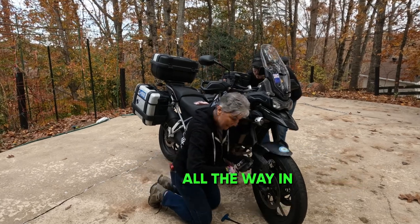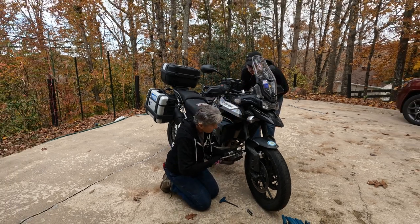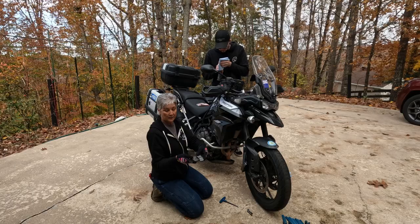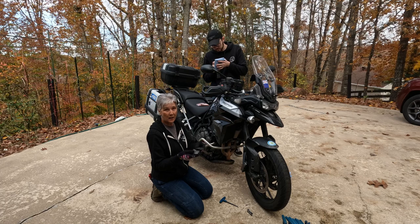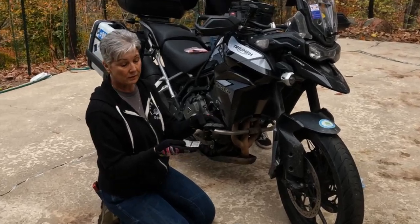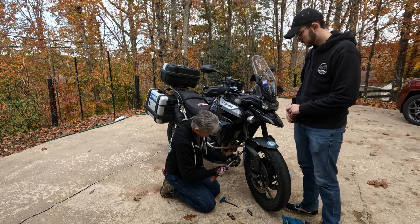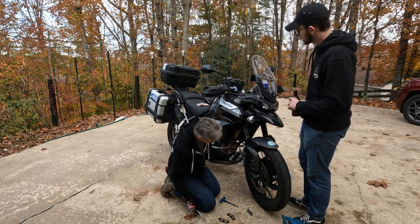You want the pistons all the way in because if they're not all the way in, then the calipers with the new brake pad aren't going to fit — you're not going to be able to put the calipers back on the rotor. There won't be enough room. As you can see, these brake pads are pretty worn down. This was really close to totally scoring my rotors. So you want to keep an eye on it. Make sure that you can still see those little ridges. That's worn down — time to change it. Don't ever ride with brakes that look like this.